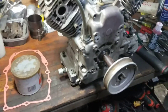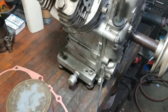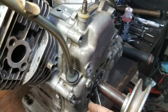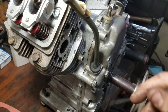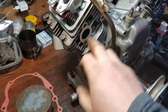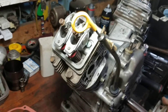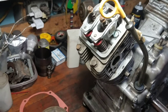I left the gasket off so I wouldn't have to worry about getting it soaked in oil. First thing that's going to line up is the oil pump — make sure the oil pump gears line up with the timing gear. You can stick a screwdriver in and rotate that gear a little bit until it lines up. Then the camshaft starts to line up with the sump cover almost the same time the seal comes up to the lip. You get it up to the dowels, watch your gasket, and if needed you can stick the screwdriver up against the cam gear to get it into the sump cover. I threw the heads on without the gaskets and tightened up the lash — just to make sure everything clears. Because there's no head gasket in there, if it's clearing without one then it should clear with one.